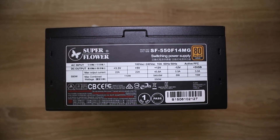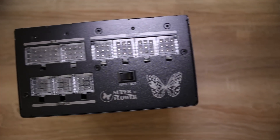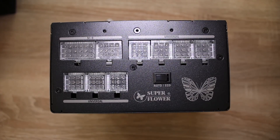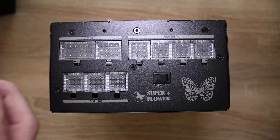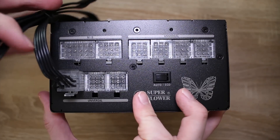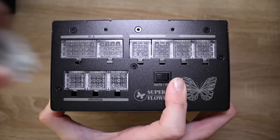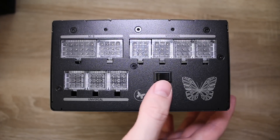Here are the specs and the sort of numbers they suggest, but basically it's a fairly nice, fully modular power supply. On the rear, you do get a relatively proprietary connector type — you get the motherboard 24-pin connector which plugs in via two large connectors on the top left, and then everything else including the 8-pin, the PCI, and the SATA connectors are all part of this universal connector, which is really nice, simple, and very easy to work with.